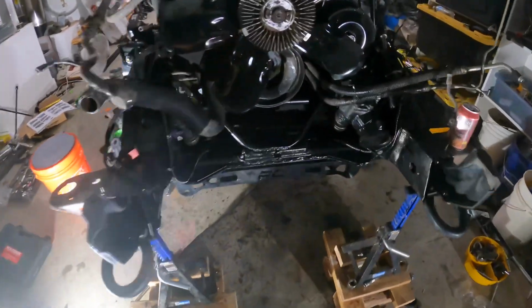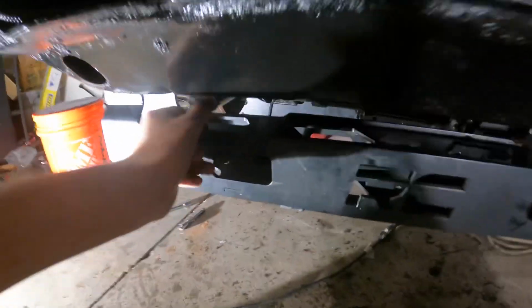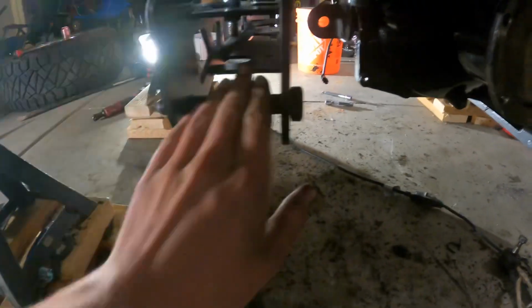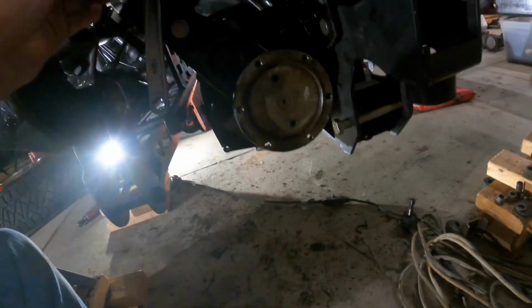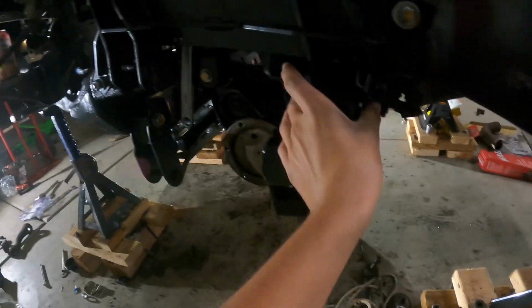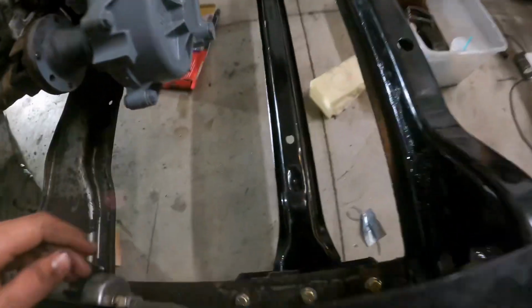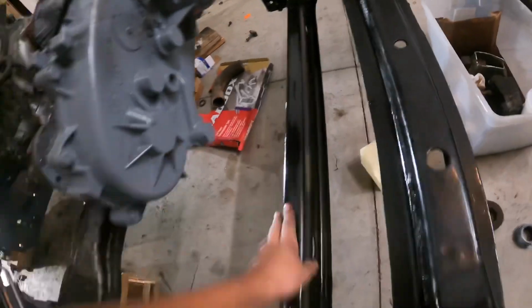So it got dark on us, but that didn't stop us. We got these little steering links in here, which comes up to this. That steers, obviously. You come through, this is the front drop bracket here. The lower control arm will mount here. CV axle. Diff's mounted up in there, as you can see there. Everything's torqued to spec. The two upper control arms will sit up here. And these brackets, shock just mounts up in there and is a longer one. Come back here. Got this into place. Got the drive line back in.